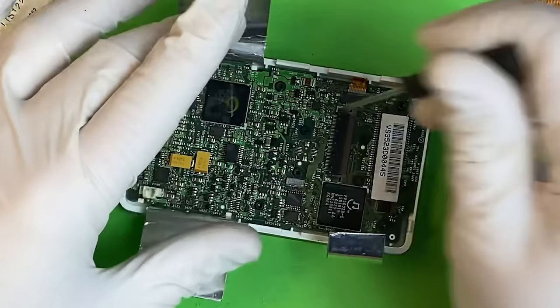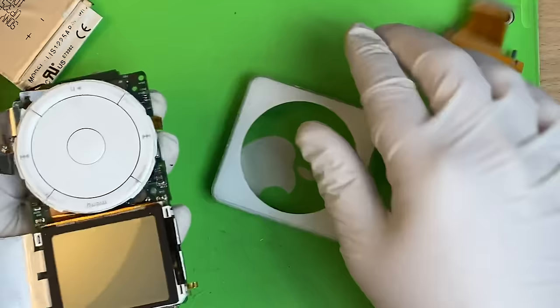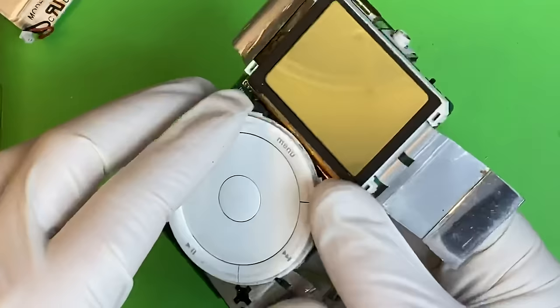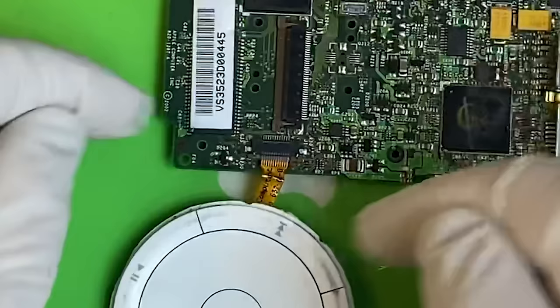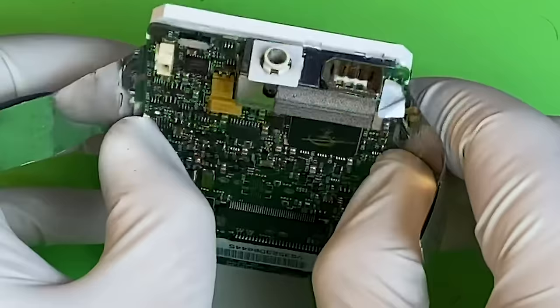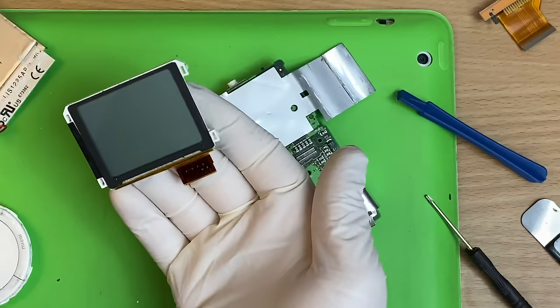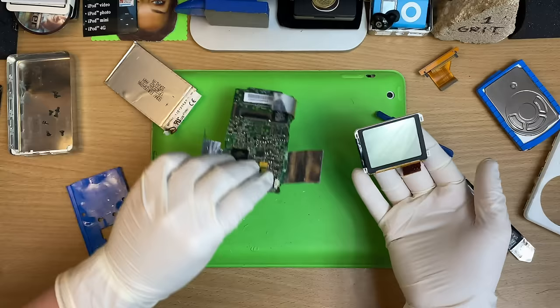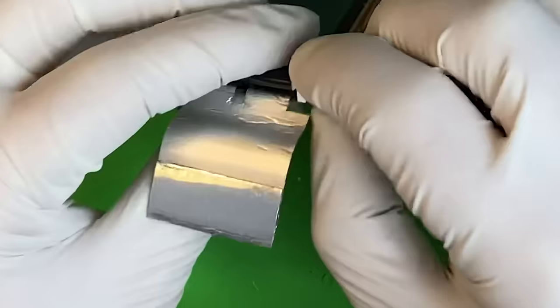Pull the tabs toward you only a little bit, then the hard drive cable comes out. Take the star driver and undo the screws. If you want to replace the front case, now is when you do it. The click wheel is removable — Apple, you've learned! The same brown connector tabs: pull them toward you and it should pop out. There are very fragile clips holding the display in. Do the top ones first, and voila — one display up and out. If you need to replace the display, now you jump back in.